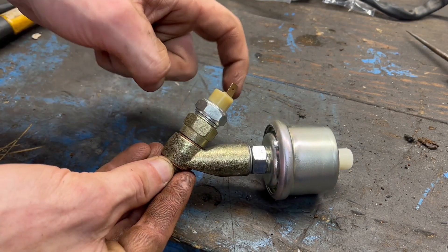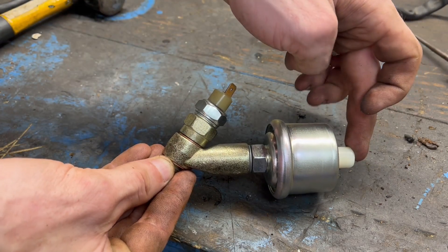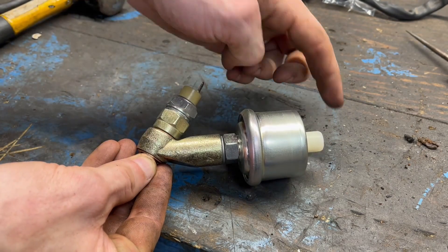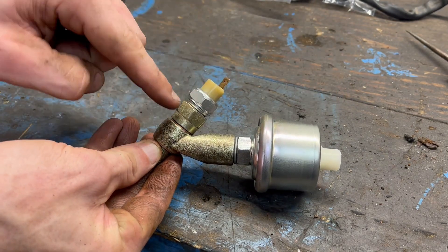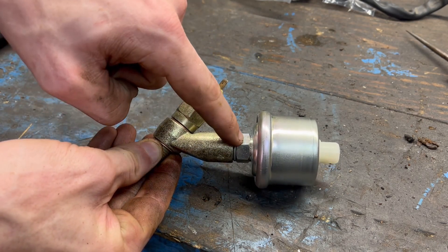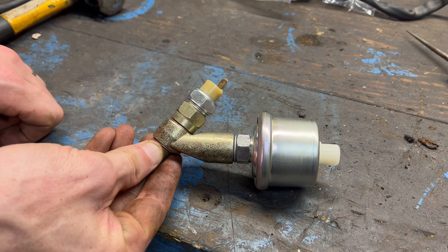This is the basic assembly of how that's going to go on the car when we remove that dummy light sender, because all that's in there right now is just this part here. We're adding all of this and running an extra wire from the top of the pressure sender to the back of our gauge, just up through the firewall and back through the dash. When I'm down there I'm going to tighten these down and get this tight first, then this on top so it's all sturdy, then tighten down the sender on top of that. Then we'll move to the dash, pull it off, and start running some wires.